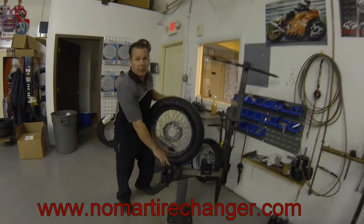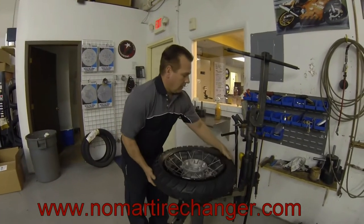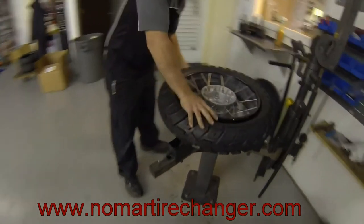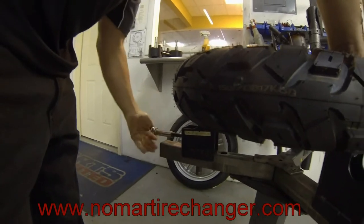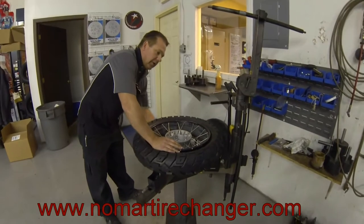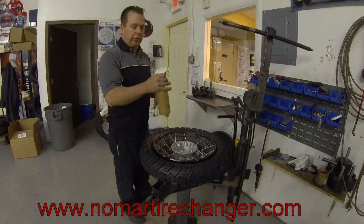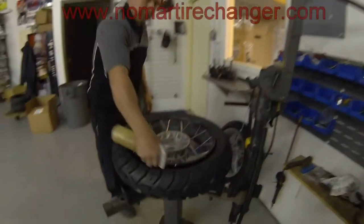Positive clamps do have the tall spools on them, which is required for the GS wheel since the lip is so thick. Take the wheel down, catch the back closest clamp, catch the side. Set that by hand, then use a ratchet to snug it up. You don't have to extremely tighten this wheel — just get it until it's snug. So we've got the tire mounted and secure. This is spray lube, which is our paste mixed with water. Put a light coating all the way around.